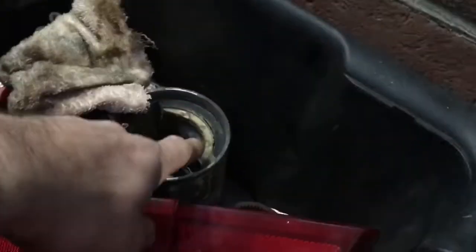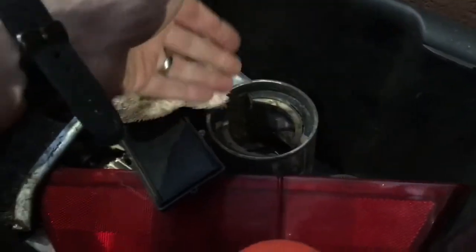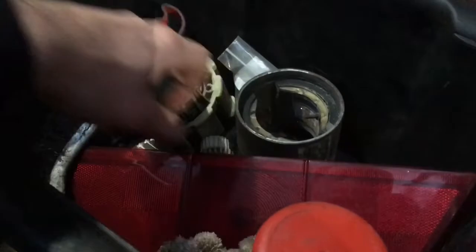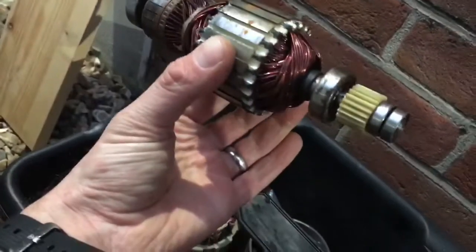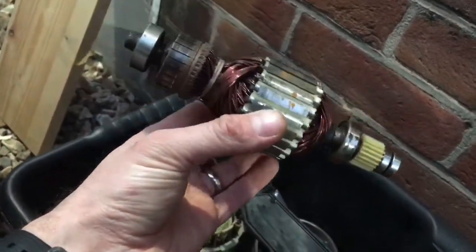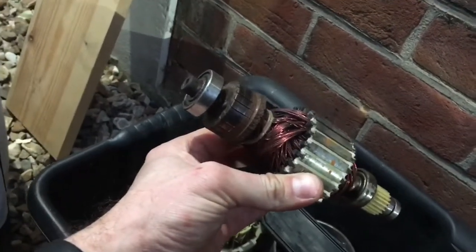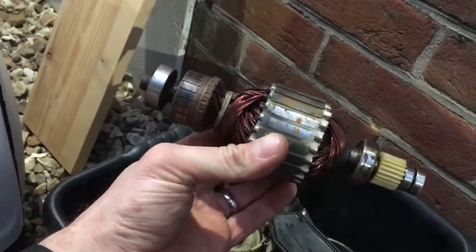Obviously, we need the broken magnet, broken motor section, middle section here. That's a trash paperweight, so we have to have one of those. Everything else looks good. Obviously, we won't know if it's got any damage to the rotor until I clean it and put it in and spin it. So hopefully it's okay. The bearings are not smooth, but they feel like they just need oil, and they feel fine. So I'm hoping that there's no damage to this, but you never know.